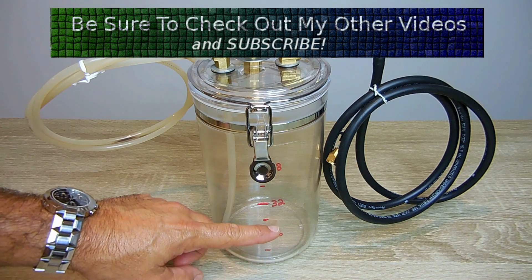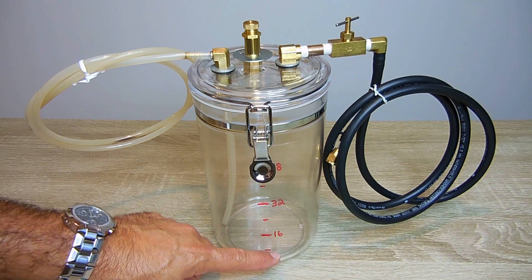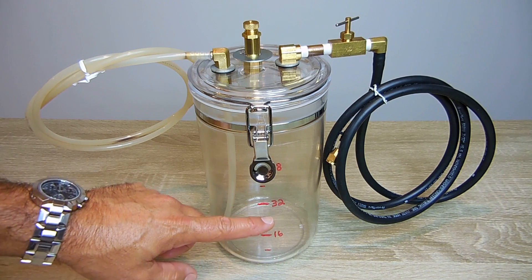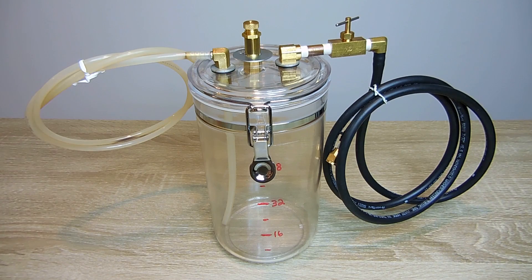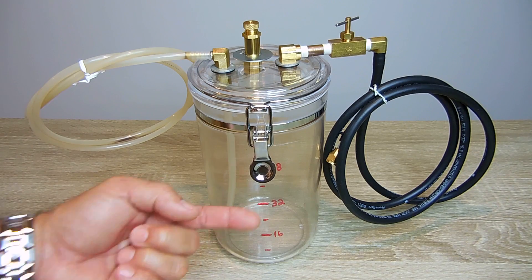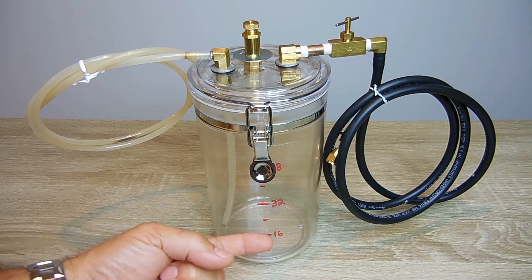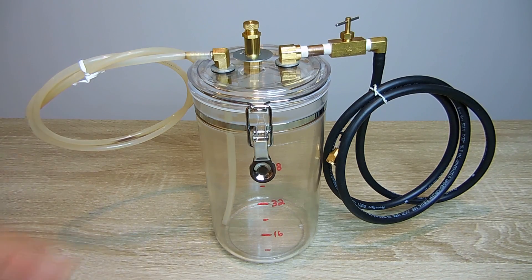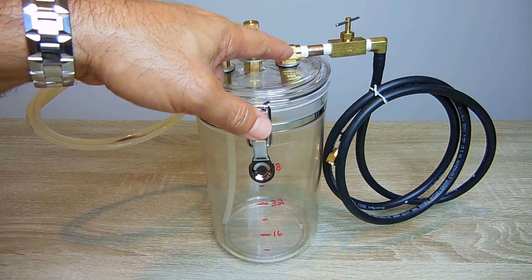What I can do is, say I wanted to take 32 ounces of oil — 1 quart — out of my vehicle to put an additive in. When I turn on my vacuum pump and it gets to right around there, I could close that valve and turn my vacuum pump off, and there's still enough vacuum inside this container to draw it up to that 32-ounce line. This allows me to turn the pump off and still have vacuum drawing the fluid into the container. But if you just want to use your pump on all the time and shut it off when it gets to 32, you're not going to need all these fittings.